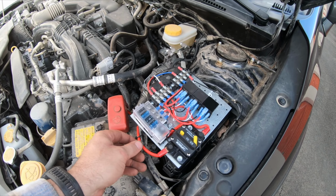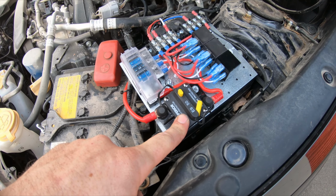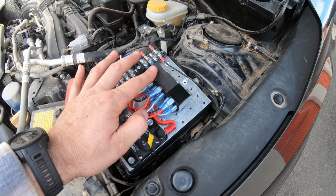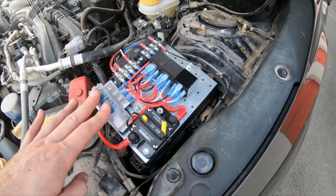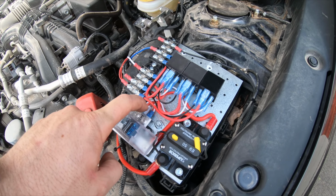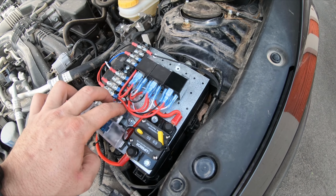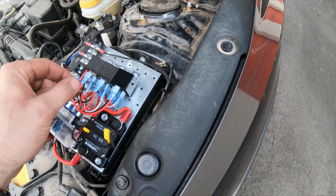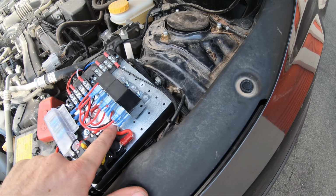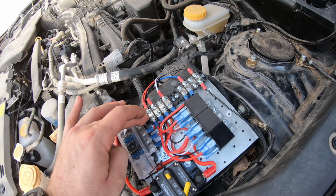Okay, so this is what I've built. It's a 3 relay pack. I've got a fuse block, a disconnect and breaker, 50 amp, and 3 relays. So what happens is we've got our power to the actual coil and the power to the accessory coming off of these taps, and they go in, and top switches to bottom when the coil is engaged, which sends power over to these blocks right here.